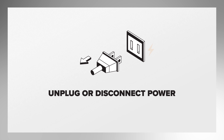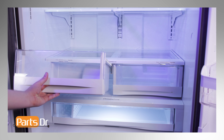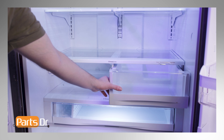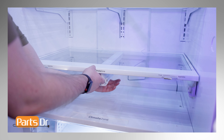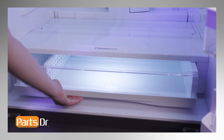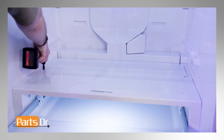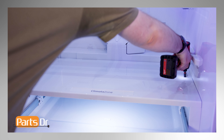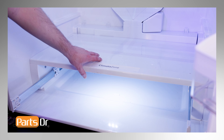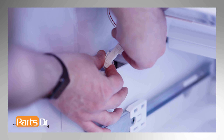Next, we will be removing the fresh food evaporator fan motor. Since we will be working on the refrigerator's electrical components, disconnect the power to the refrigerator. Start by opening the doors. Pull the drawers forward, lift up and pull out to remove. Remove the crisper frame by lifting up and sliding forward — be careful as the glass panel will come out with the assembly. Remove the deli drawer by pulling forward, tilting up and sliding out. Using a quarter inch nut driver, remove the two screws holding the front deli cover in place, then lift the cover up being careful as it is still connected by wires. Disconnect the electrical connector by depressing the locking tab.